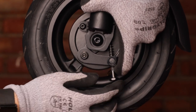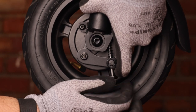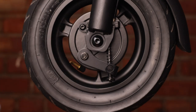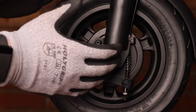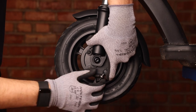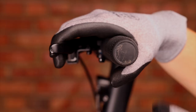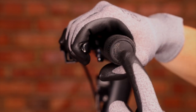If your brake is too loose like this one, we can then tighten the knob. We can now check the brake on the handlebars to see how the adjustment is. Now if your brake is too tight, we'll just reverse the process — lift the arm again, gently pull down the brake line, and loosen the knob. A properly adjusted brake should leave you with about one finger width of space between the brake lever and the grip handle.